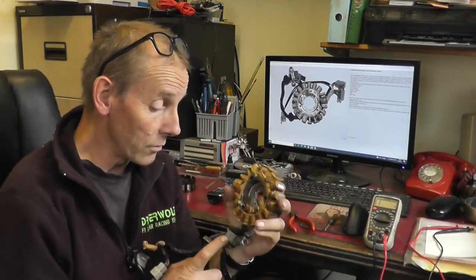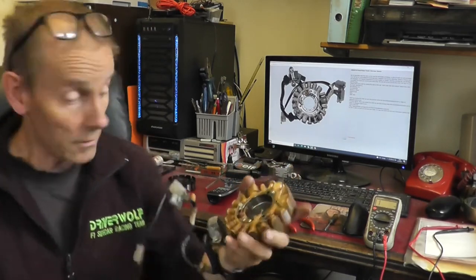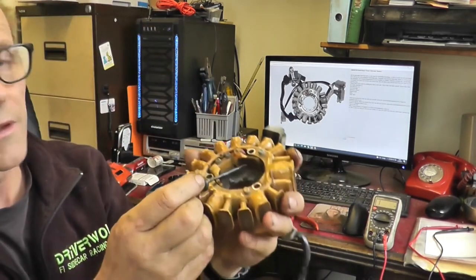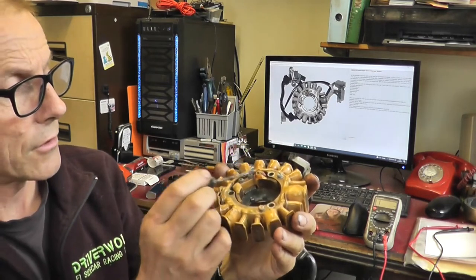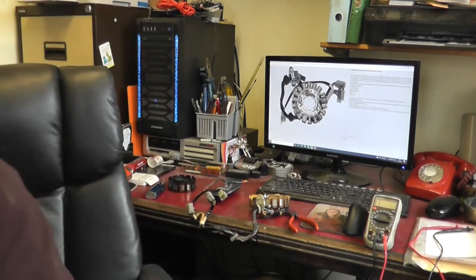The 400 automatics are a different kettle of fish because the charging wires cross over them and they're difficult to do the high speed source coil on those. Anyway, I've checked the pickup coils — the internal one and the external one — they're fine. They generally either give a reading or none at all and very rarely give problems. I've never known an external one to give problems. However, problems with the internal one — corrosion gets in and starts messing with the laminations. It's a common fault. In fact I've got another one in; the guy says it's not revving out and I'm suspecting that's what it is.